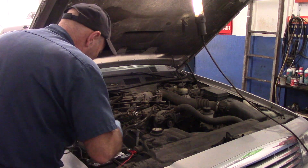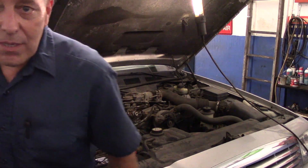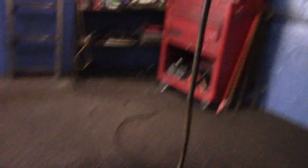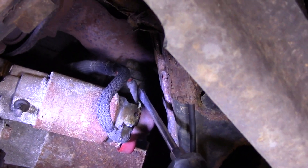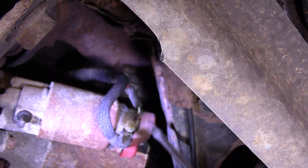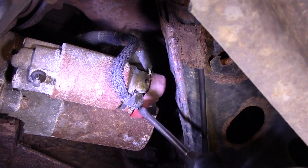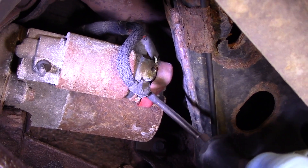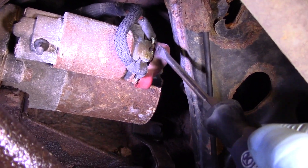Let's connect our power probe up first. What's nice about the power probe is it has a light in there too so you can see a little bit. Now underneath the car — this is going to be a little tough to film because it's tight quarters. This lead here is the main lead coming down from the battery; we need to check if we have power at that lead. This lead here is the start side of the starter — that's about 8mm or 5/16ths. We have to check when the key is turned to the start position to see if we have power to that wire. If we have power here and power here in the start position, then we know the starter is no good.